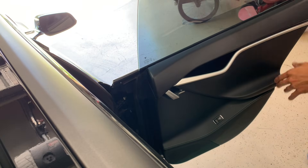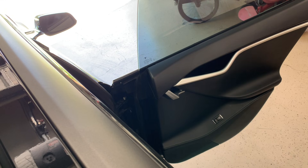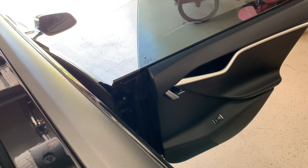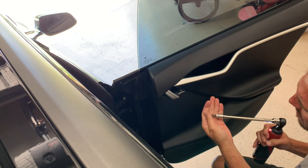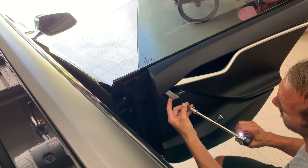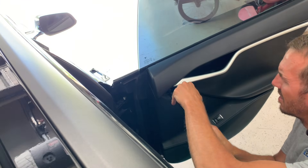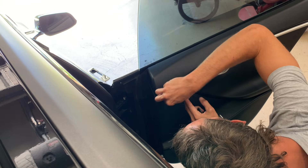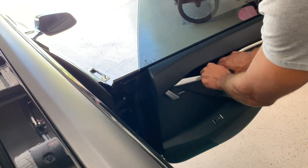Push in the top first and get those clips connected. Apply pressure to the opposite side of the door so you're not pushing only on the hinge, and work your way all the way around to secure the rest of the grommets. Then tighten up that 10mm bolt and your two T30 Torx screws. As you can see, the door handle is working because the other one just popped out. Finally, cover everything up with the beautification pieces — the plastic one goes in right side first, then clip the left side in, and the two tabs go in. That's it.